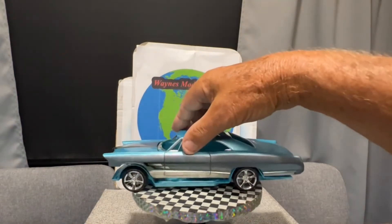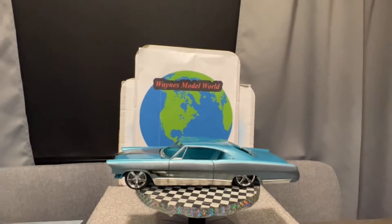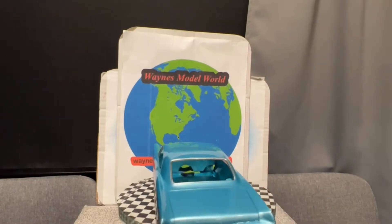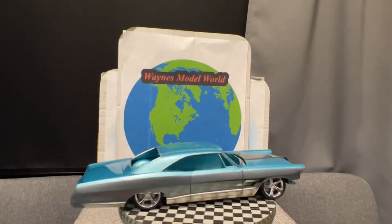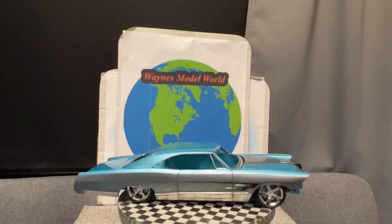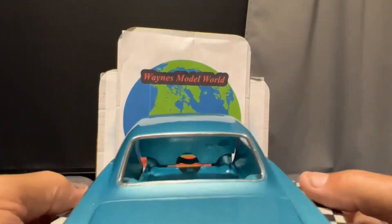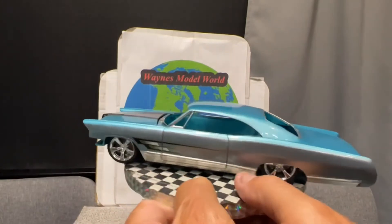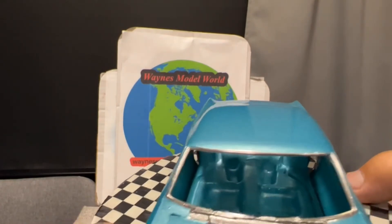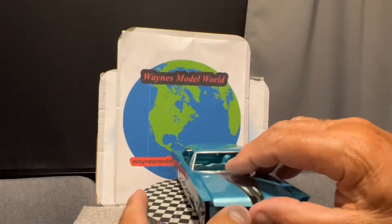We still have a ways to go. I'll let this clear coat set for a couple of days, then sand and buff it — do a little 5000-grit and buff it up. The bare metal foil around the windows is done — around the back glass and the windshield area. I also chrome-plated the intake vents.